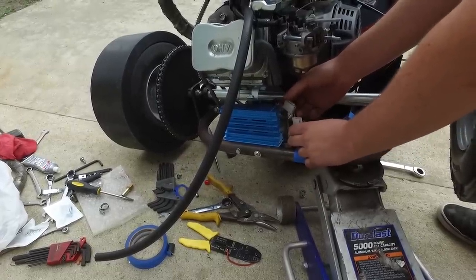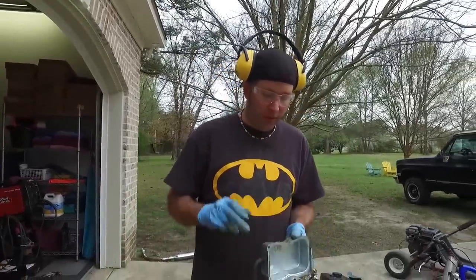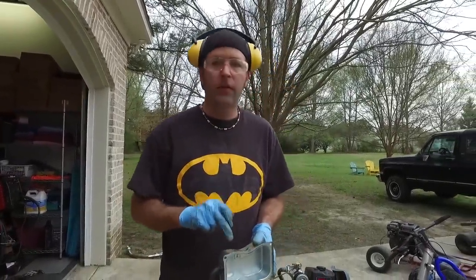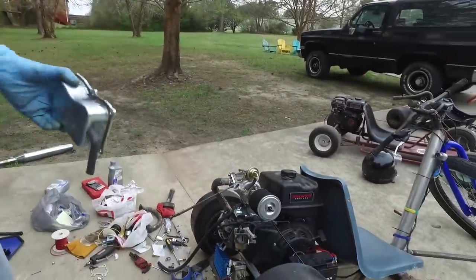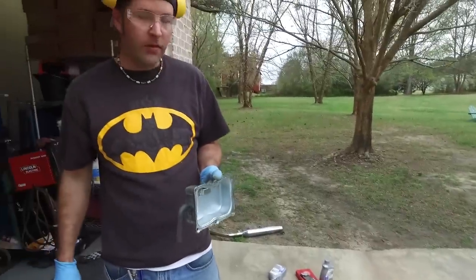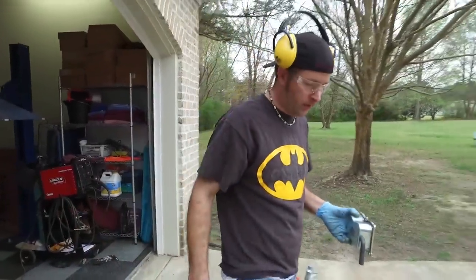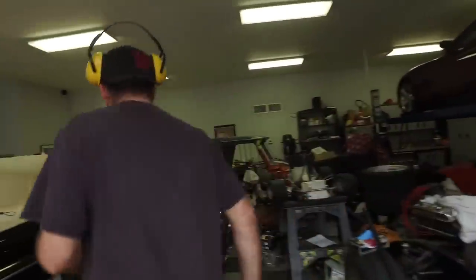People are gonna think that the engine's knocking. Yeah. I'm gonna drill the turbo oil return right into the valve cover. There's nice holes going right down into the crankcase. So this will save us hose and headache. That's good, hose and headache.